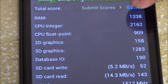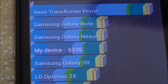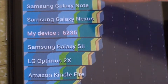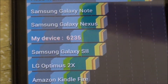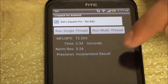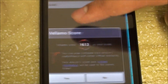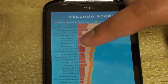SD card performance also increased slightly. In the bar chart comparison we beat the Optimus 2X and the Galaxy S2 — though remember those devices aren't tested with other ROMs or overclocked kernels; they're shown as stock. With the Fox kernel, Linpack hit 72 megaflops though inconsistent, and 65 with consistent results. Browsing speed increased as well, technically beating every device in the comparison, though I'm a bit skeptical of those results.